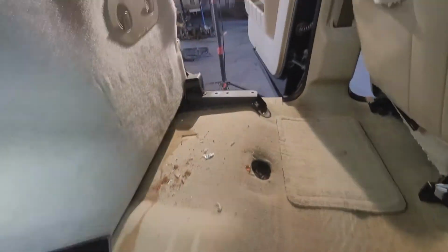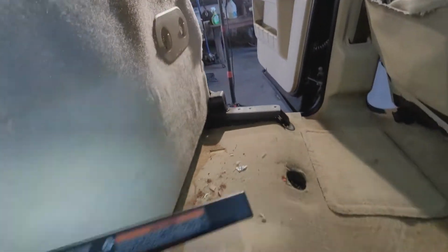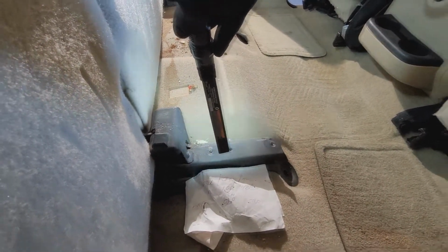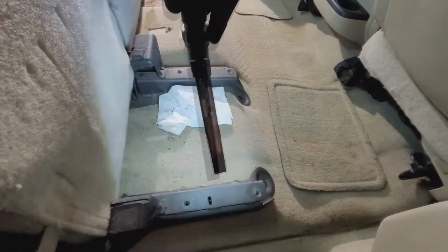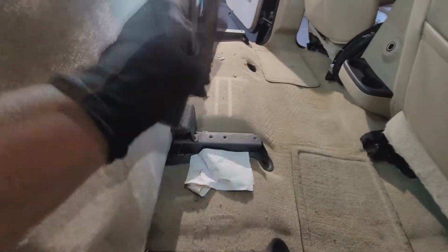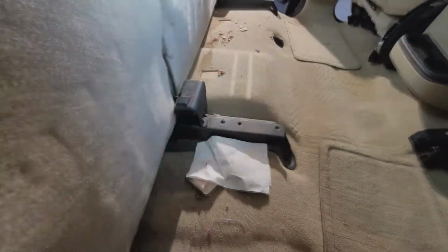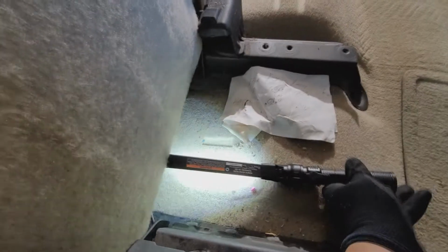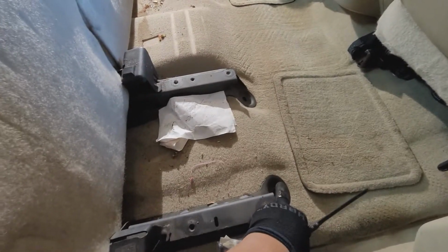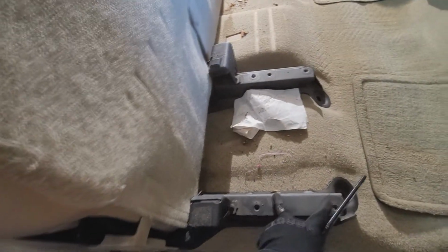Anyway, I had to pull off the floorboard there, that fold-up floorboard you can see over there. These are number 40 Torx heads. Okay, there's 6 of them, 2, 4, 6. Number 40 Torx, but get them off, because trying to get in there for those 18 millimeters is going to be a pain in the butt, and you're going to need to get in at a good angle to loosen them up. So just letting you all know ahead of time. It was 18 millimeters here, 18 millimeters in the back, and these are 40 Torx.